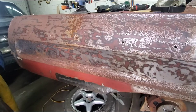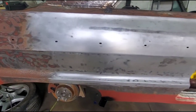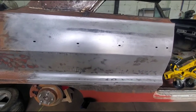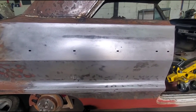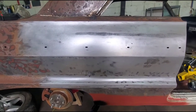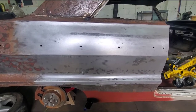While waiting for the paint to dry I went ahead and started stripping rust off the quarter. Somebody left this outside and it wasn't pretty, but it cleaned up fairly well. I started at 40 grit, went to 80, 120, 180, and then 220 just to see what it would look like — and that's good enough to put epoxy primer over.